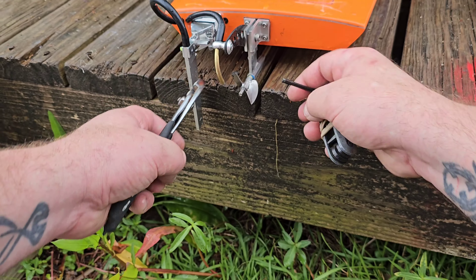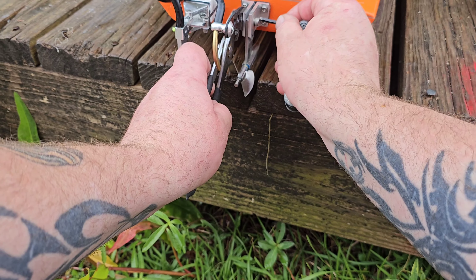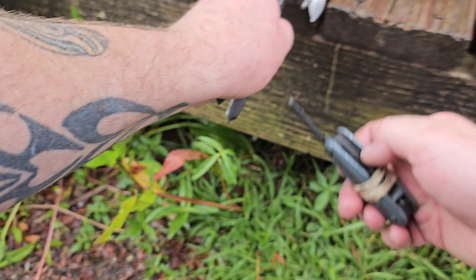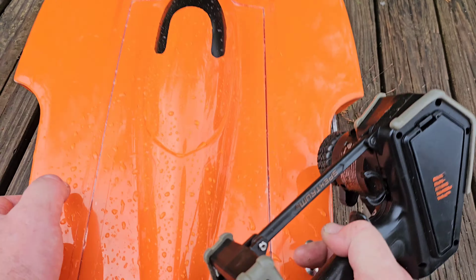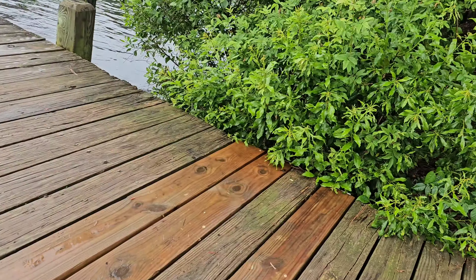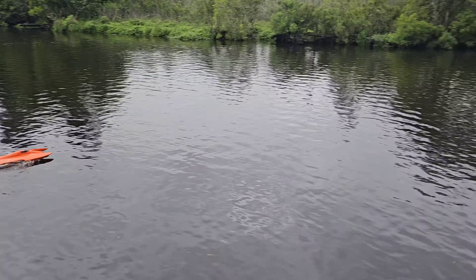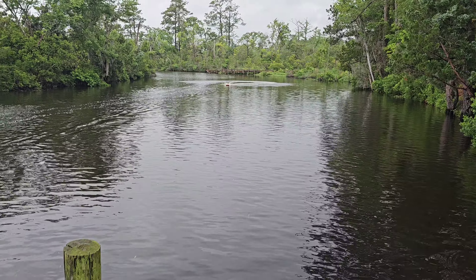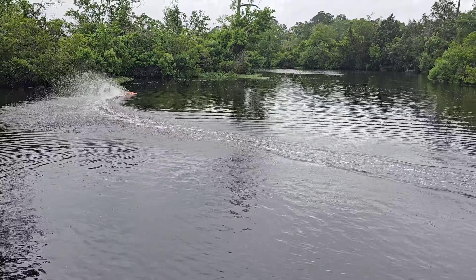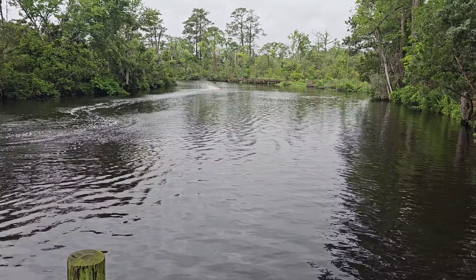I'm going to drop it down just a little bit deeper — it looks a little deeper than what I've been running. I really didn't like that higher strut position. The angle of the propeller could be positive or negative just setting it up on the dock, but it actually looks flat, so let's try that. That's a little bit lower than what I've been running. The boat was running so good I really hated to mess with that. So this is about where I'd like to run it, with the back of the boat up out of the water, less prone to blow off. I had that bench tune dialed in.